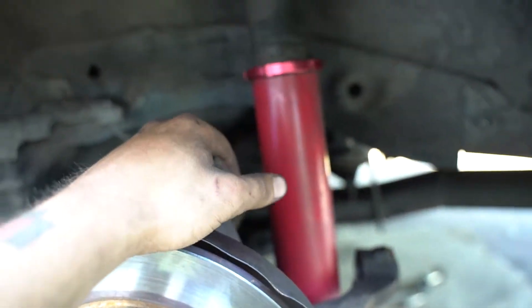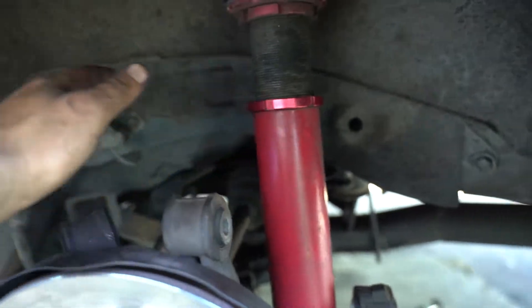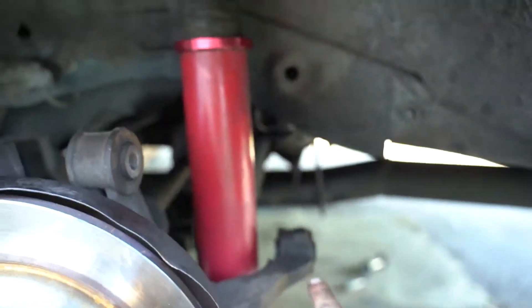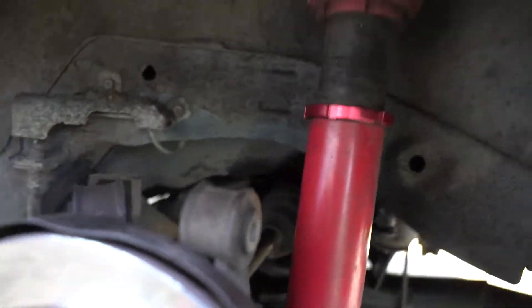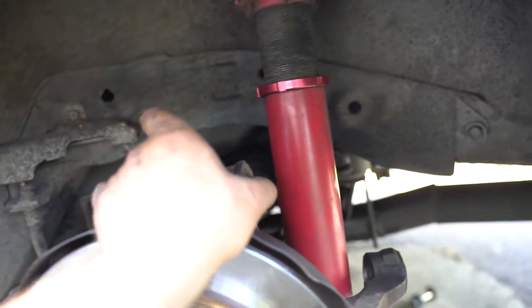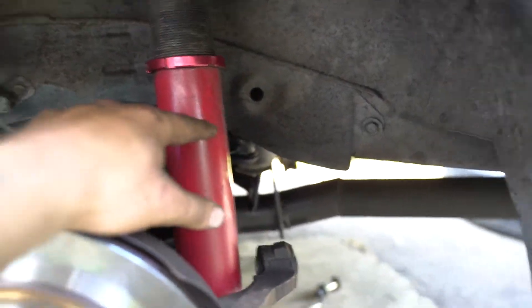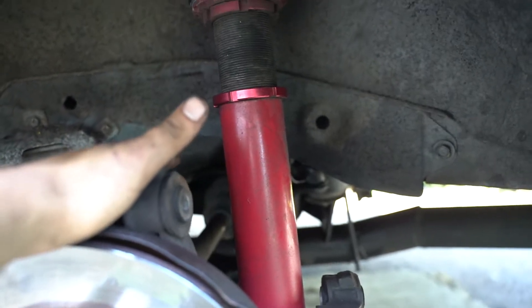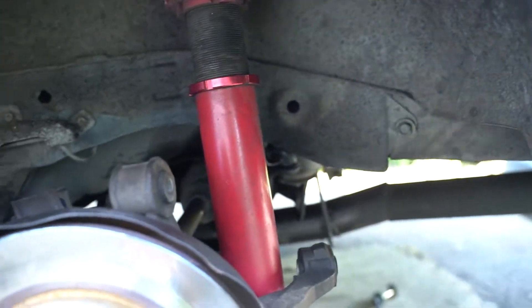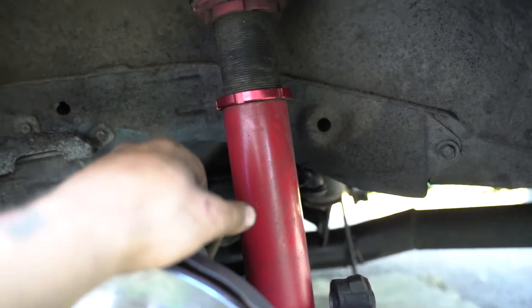It's pretty simple — two bolts. I have them organized. There's one up here, one back there, one right there, one right there, one back there. The one down here is a bit of a pain because it's right behind the subframe cover. The camber arm — getting that one off was a nightmare. The back bolt just did not want to break loose, I was almost stripping it. What I ended up doing was taking my breaker bar and actually tightening it to break it, then loosening it afterwards. It broke loose pretty quickly after that.